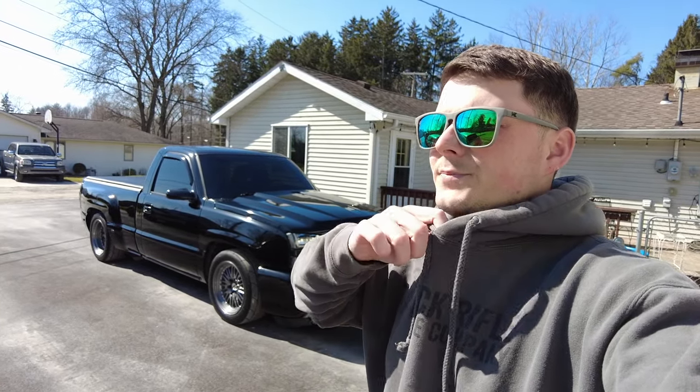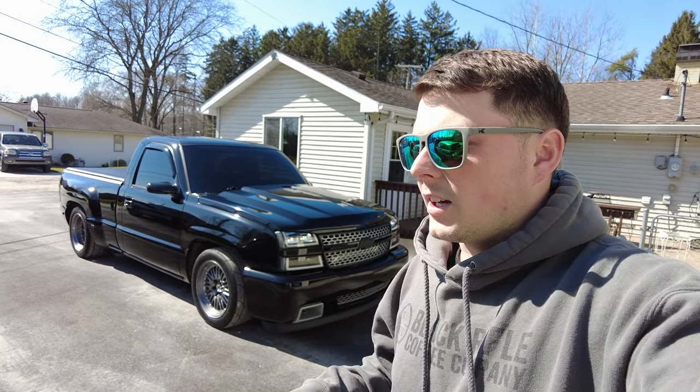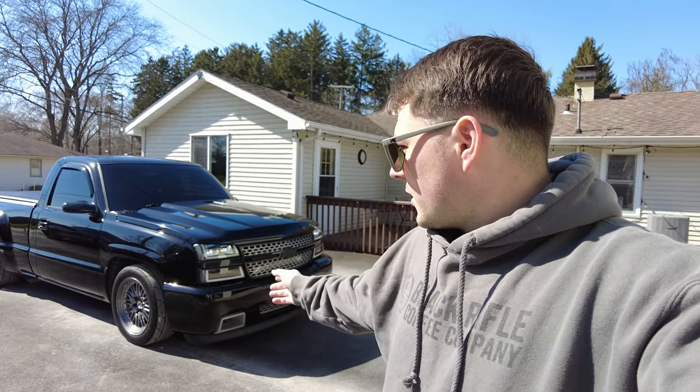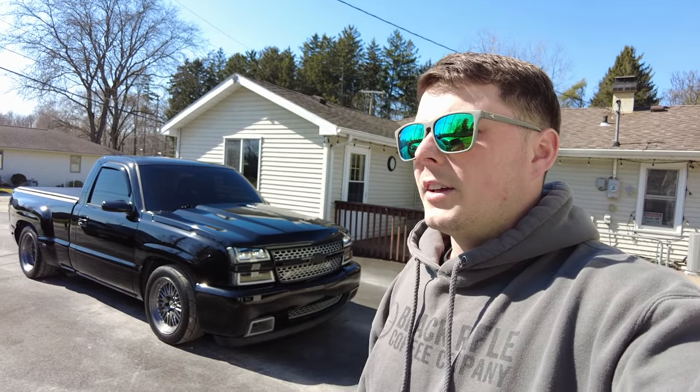Wow, I cannot talk. Trying to find drag tires, because these are Mickey Thompson ET Street SS's, so pretty much the highest I can go before it's no longer DOT approved. Trying to find, since it's all-wheel drive, a wide drag wheel for the rear that's the same tread pattern as a drag wheel for the front is almost impossible, like completely non-existent. The fronts are a 28 by 10.5, so pretty much what small tire no prep guys run on the rear.